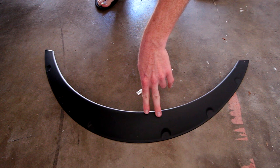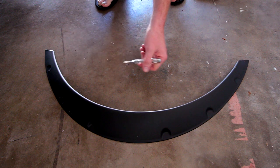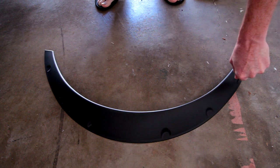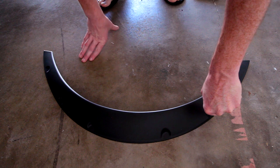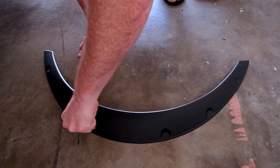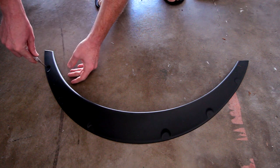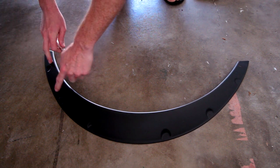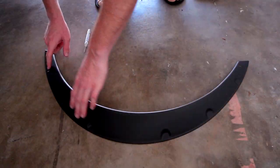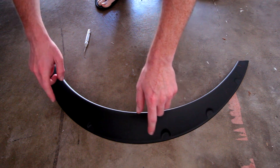Most eBay flares work the exact same way. You'll notice there are flat sections that are dimpled out of the flare — this is how you mount the flare to the body of the car. Using a punch, you punch little holes in those flat sections right in the center, which gives you a starting place to drill out holes in the flare. With this kind of plastic you want to use a step drill bit or start with a very small drill bit, because the plastic is very brittle and will shred if you go too fast.